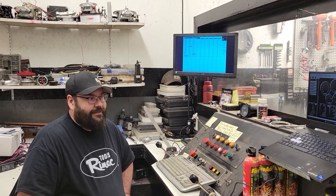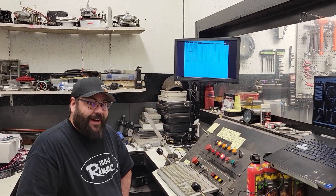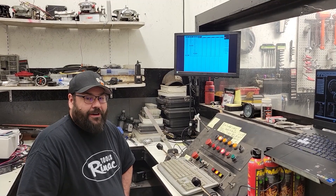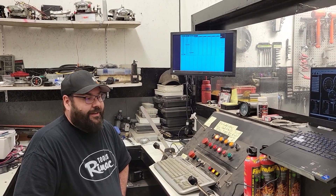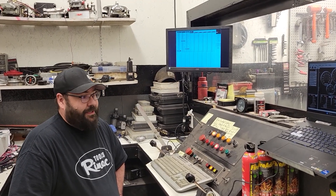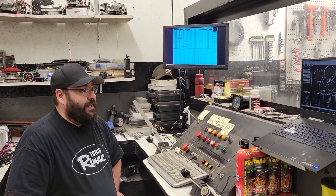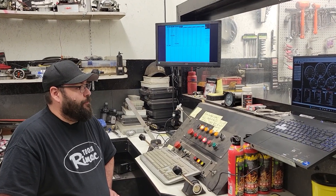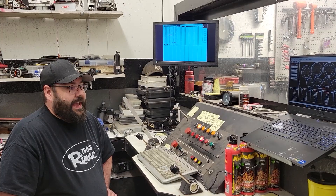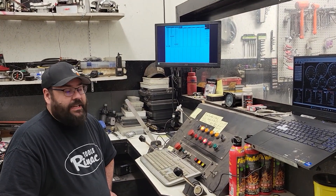I think we're stopping here. We have made 687.5 horsepower and 616.6 pound-feet of torque on a stock 5-liter bottom end. The plugs say we could put more timing in it — I'm not putting any more timing in it. We could probably lean it out some more — I'm not going to. This is an eminently safe tune-up and this block isn't going for the world record. We made quite a bit of power and the Boostane Race E85 has made it ridiculously easy. We have not had any fuel-related issues whatsoever.